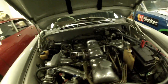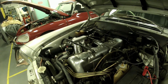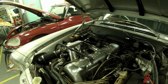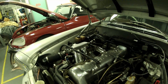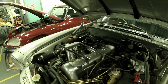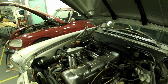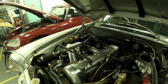This engine had its genesis in the M180 engine which came out just after the Second World War and was ultimately used right up into the mid-80s, although it probably had its widest use through the 50s and 60s. The Rover engine we saw before was producing around 134 gross horsepower, and this engine is rated at 170 gross horsepower or 150 net — so because it revs much higher it has higher horsepower, although it has a lower torque figure. The characteristics are very different; you really keep the revs up and use the transmission to change it yourself even though it's an automatic, because it performs much better at around four or five thousand RPM, whereas the Rover engine is much happier at lower RPM ranges.